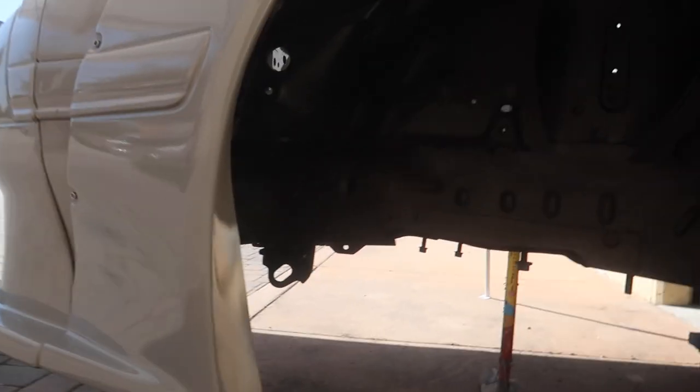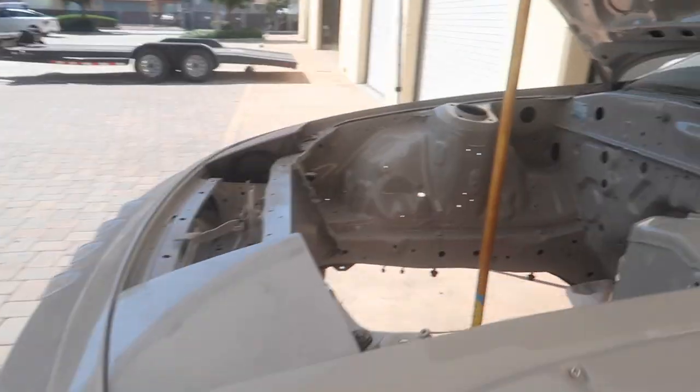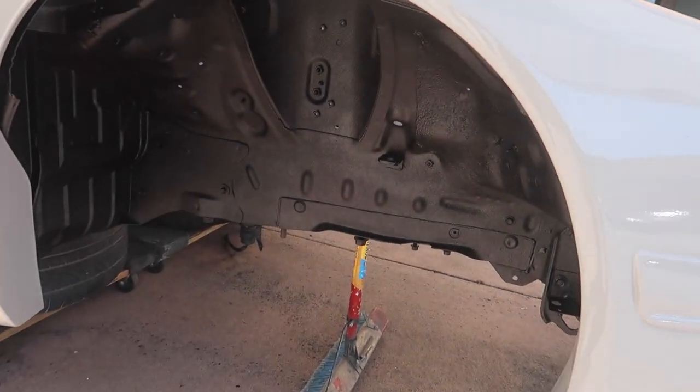That concludes painting the wheel wells. You're only supposed to do two coats of the rubberized undercoating — really simple, you don't have to do too much. Thinner coats are better. We're super stoked on the outcome. It can really change the game underneath there, even if no one's going to see it, it's got to look good. One thing I learned: don't underestimate masking off areas you think won't get hit — better safe than sorry. I'd definitely mask off a bit more next time. Had a great time. Thanks to Adam. Knocked it out in about three to four hours. Thanks for watching, stay tuned for the next video!